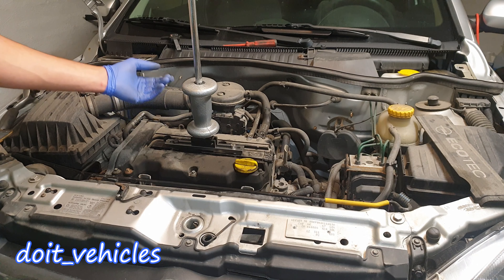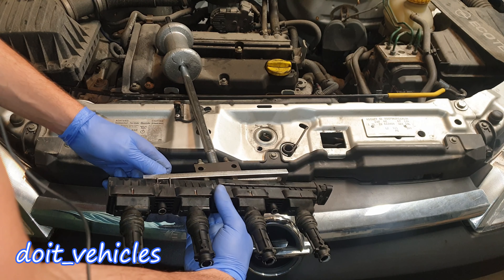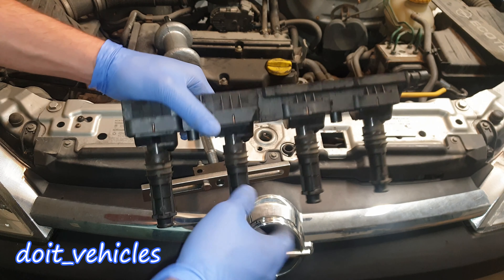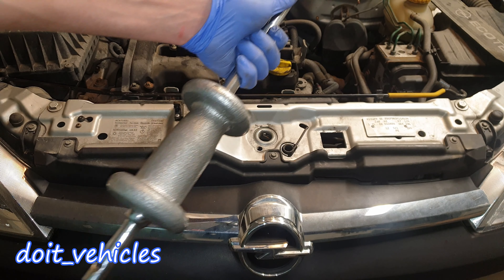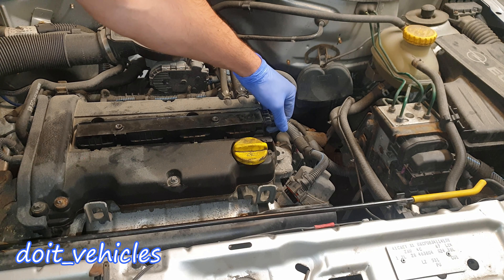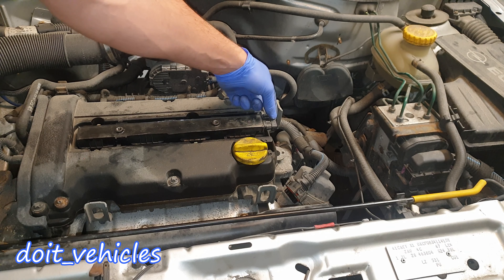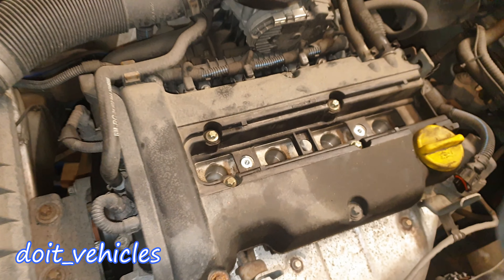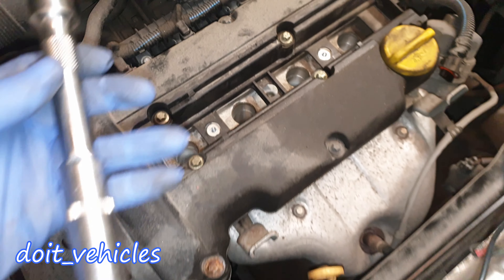With 1 slide this should come out — there we go. Now simply disconnect this tool from the coil pack assembly. In these special occasions it's very important to have the right tools, otherwise your life is going to be very difficult. You could also press from the side but that can be dangerous and put extra stress on the connector, especially if it's very stuck in there.